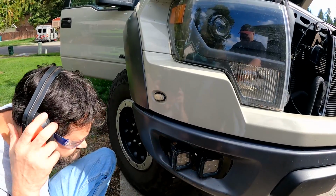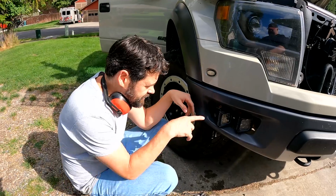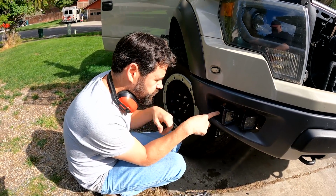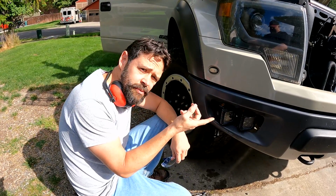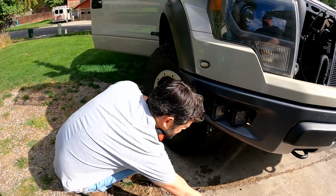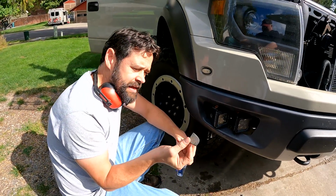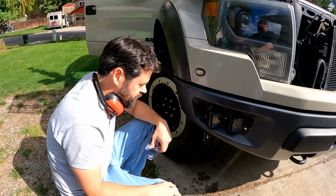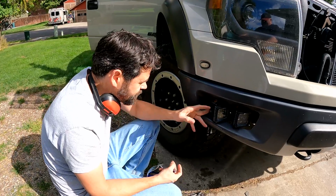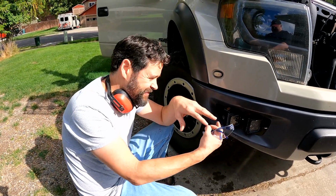So that bracket's off. With these old lights that we're swapping out, the problem is these bolts go through the side. The bracket bolts on, then the light goes on, then these bolt through the side. But the bolts in there were designed to be held by the aluminum heat sink fins, and it was just stripping. So we broke a couple out, hoping we could get to it, but the back's still kind of in the way, and it just messed it up. But now the outside is solved. So we're going to keep working on that, but now you see what we have to do to change these.